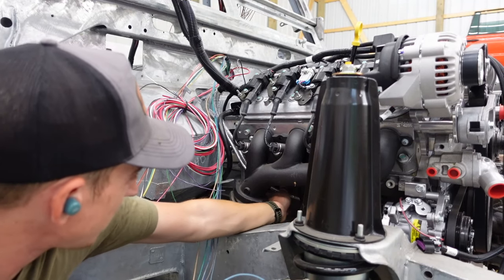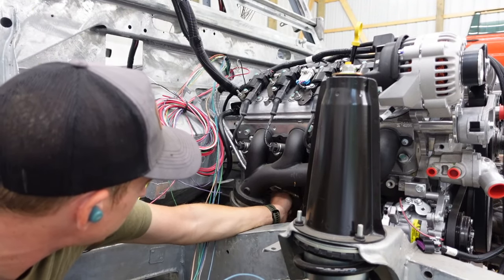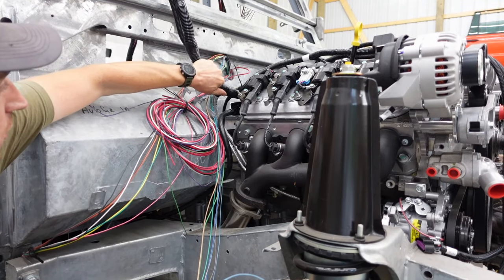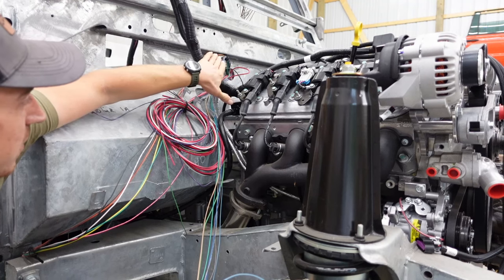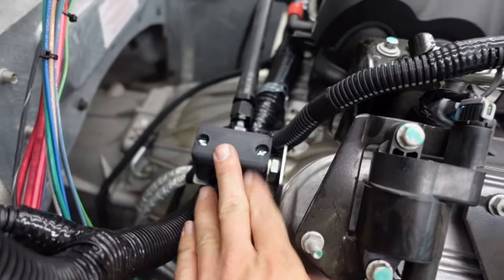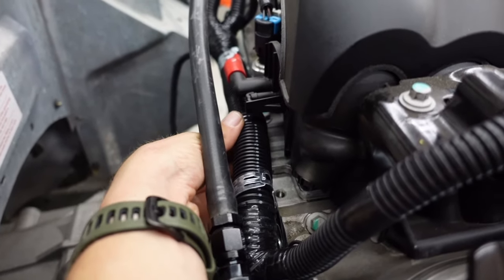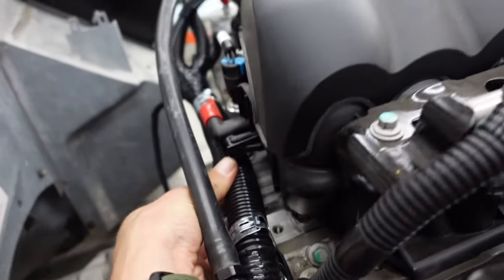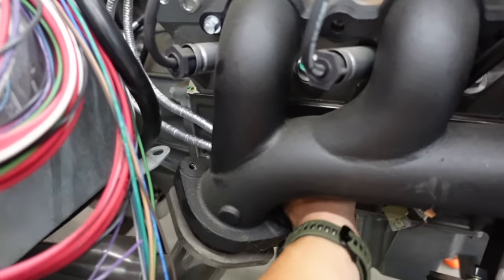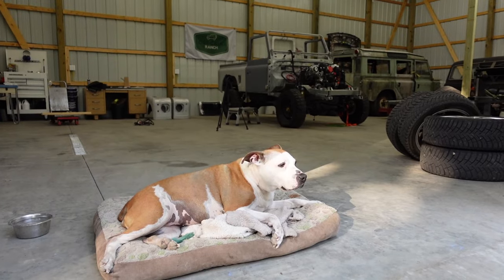The ones that go on the side of the block for the even side are a tad on the tight end as well, so I'm guessing I need to move this whole section of harness down. I went ahead and flipped that main harness underneath the fuel filter, and it now sits down at the bottom side of the valley. Everything sits at least 300 times better than it did before — and we got a visitor back keeping an eye on everything.